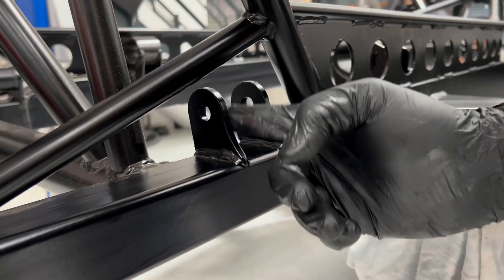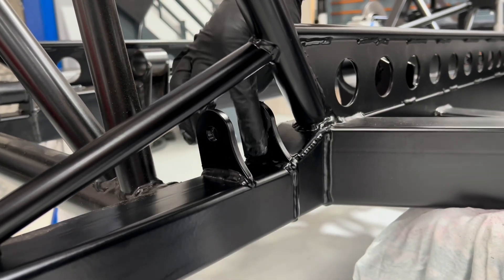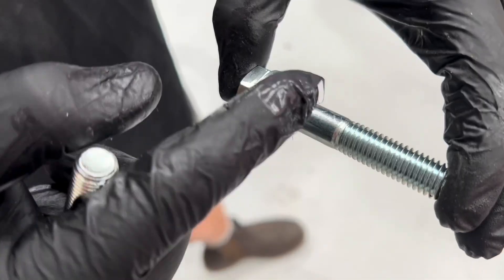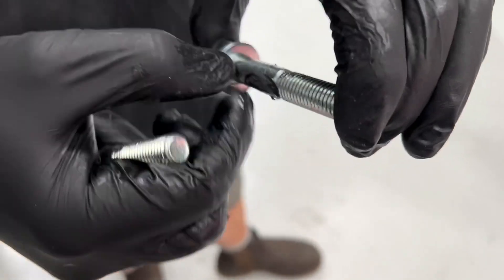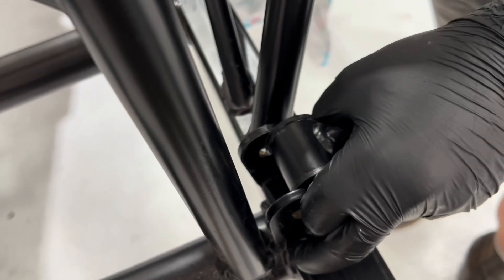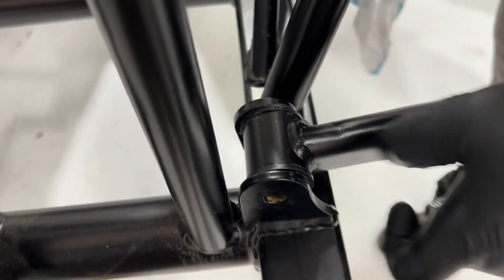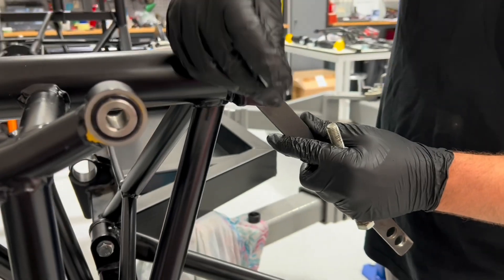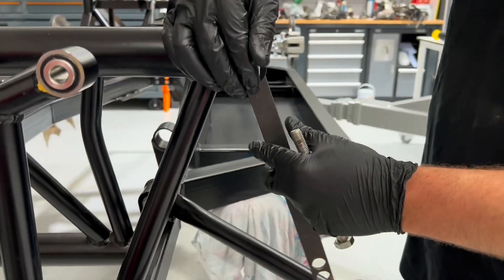You'll now need to use the moly grease on the A-arm loops themselves, and using the bolts supplied make sure these have grease on them also. Insert your A-arm into position and, using the bolts and the washers, fix in place.